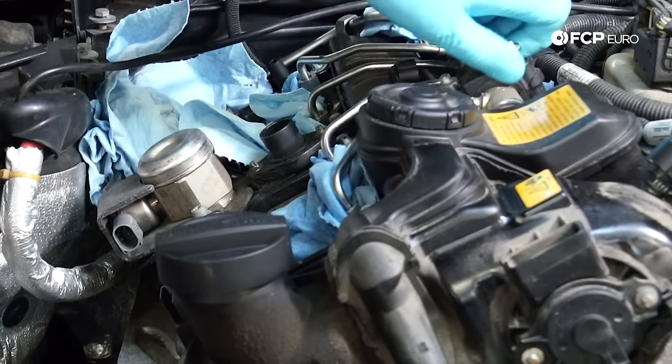Now that we have the pulse sensors removed, we're going to go down to where the wastegate actuator was. There's a 27 millimeter bolt — that is the timing chain tensioner. We're going to pull that out. Have a rag ready because it's going to be filled with oil. It's already dripping oil, so get the rag down there and then thread it out. Leave those rags down there in case any oil drips out. Before disconnecting the camshaft sprockets from the chain, I like to double-check that the timing is right by putting the timing tool in the correct position and confirming the pins align with the holes in the sprockets — showing me the engine is in time currently.